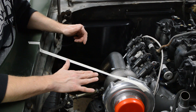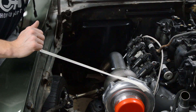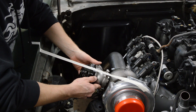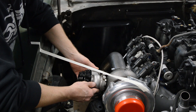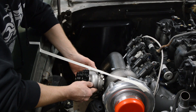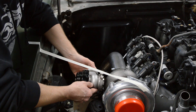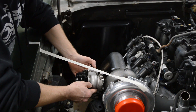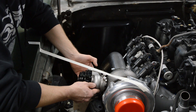I have tape here representing the hood, roughly. We're going to put the wastegate right about here — that's a little too close, so I'll move it down to right about here. There's going to be a little pipe stub on there, so it'll be right here. It's definitely going to clear the inner fender by looking at the other side. That's where the wastegate is going to go, so I made a mark on the housing where we're going to put the hole.